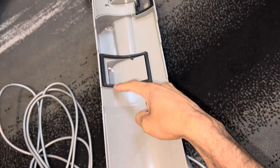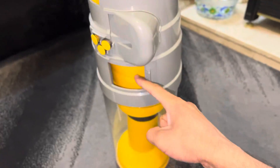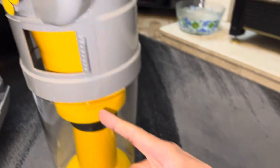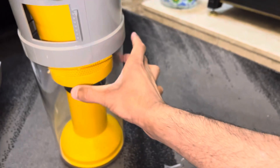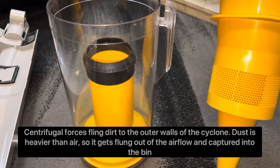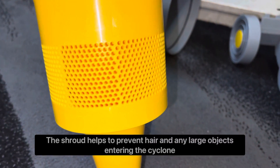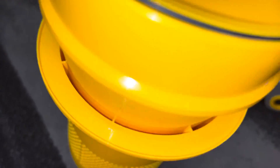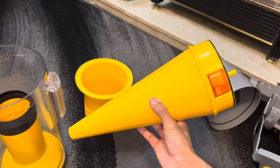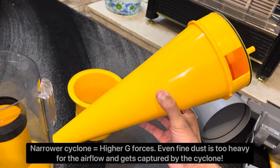When you pull the wand out, the airflow can now come out where the hose is. The dust and air travel all the way up and come out here. See how the air path is angled — it's angled so it spins against the walls of the cyclone as it enters. When the dust and air enter the cyclone it spins around in a cyclonic vortex action. This bin right here is your first cyclone, so approximately 90% of the dust and dirt gets captured in the bottom of the bin. The dust and air then go through the shroud right here, travelling up through this narrow gap.